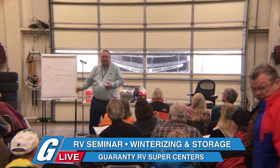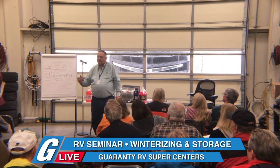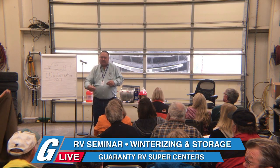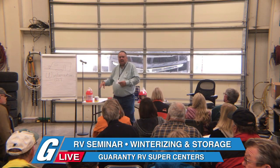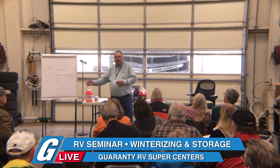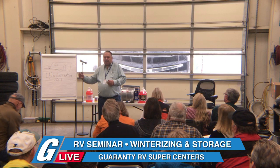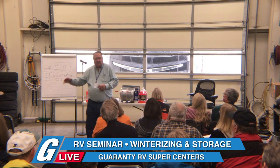What I tell people is, and I'll answer your question, but I prefer, once you open up your low point drains, you take the plug out in the water heater and flush it out. And during that time, I turn the pump on and pump out anything that's in the tank. Okay, now what if you've already emptied your water? Then there's no need to do it.